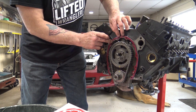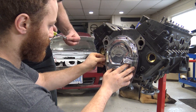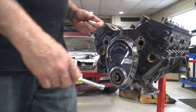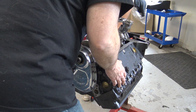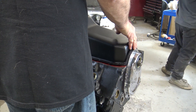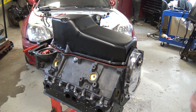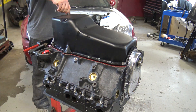The reason that this gasket looks red is because we sprayed it with something that helps seal and hold the gasket in place. Time to put the oil pan on, so let's flip the engine around. Now this is a little different than other parts because the oil pan is not flat, so you have gaskets in different spots. There are 18 bolts that hold the oil pan on because this is the bottom of the engine where the majority of the oil will sit.